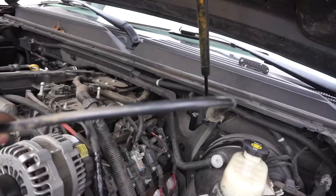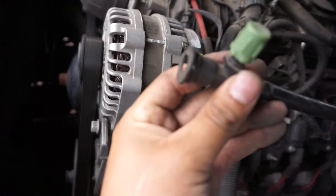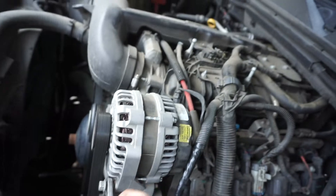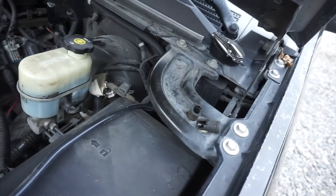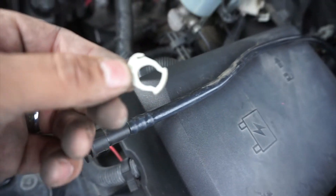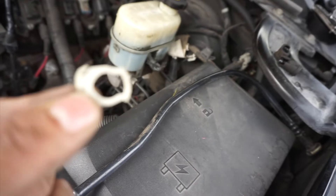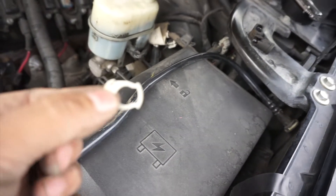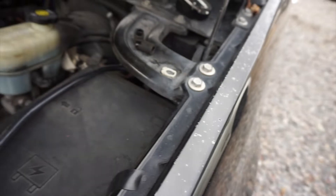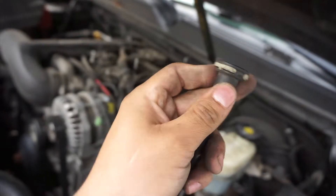One of the things you'll have to do is remove this vent hose right here. I already took it off. When you remove it from this side it has a little clip that locks it into place. As vehicles get older things become brittle, so this is the clip I took off — it has little ears that broke off on the ends, and that's what holds it. We'll have to replace this; we'll have to go to the parts store. Very common — it just breaks off.